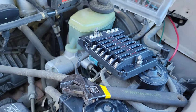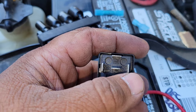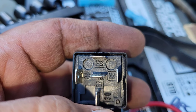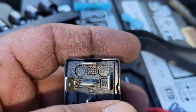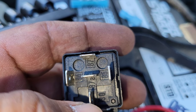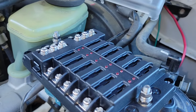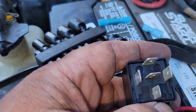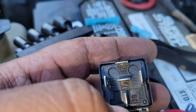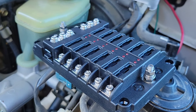So how I'm going to add power to 85 and 86 is by utilizing power coming from the fuse box inside the cabin. When I turn on the key, there should be power coming from there, magnetizing the electromagnet and making the electricity from the battery jump to 87, thereby making the fuse box have power. And when I turn off the engine, the power will shut off — it'll jump from 87 back to 87A, thereby opening the circuit and I won't have any power running into my fuse box.